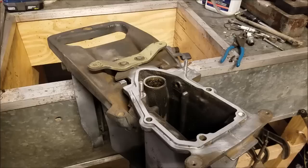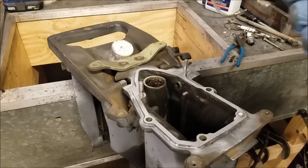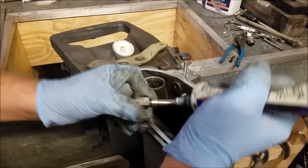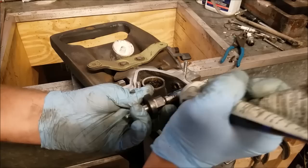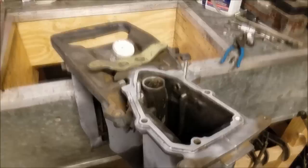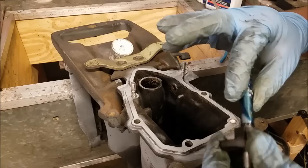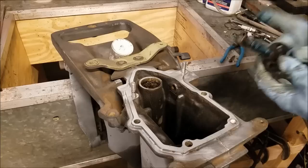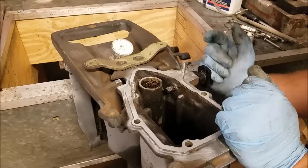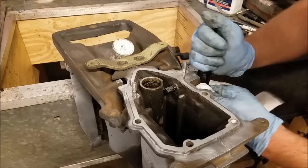As well as cleaned up the shift rod handle — I didn't go crazy with it, just got all the old grease off, made it look a little better. So it's time to start reinstalling stuff. This is triple guard grease — I'm going to put some on here. I cleaned all the old stuff off; if I do this now I won't have to grease the fitting later. I put it in a little bit just to kind of get the grease starting to spread around in there. Overdoing it here won't really hurt anything — it'll help if anything. Wipe the excess off the back here.